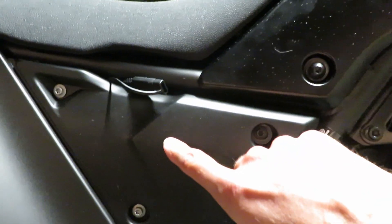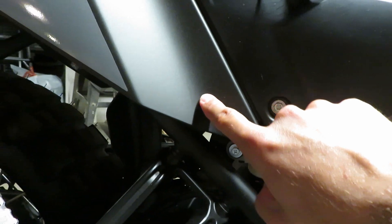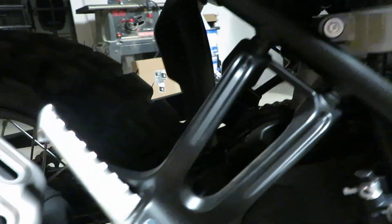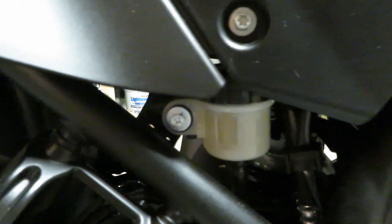What I'm going to try to do is pull this panel off here to give me good access to the reservoir. I think there's still a flange bolt on this. You could also just crack the bleeder on here, but I don't want to make a huge mess of my rear swing arm, so I'm just going to try to get access to this and either siphon it out or maybe just spoon a little bit out of there.